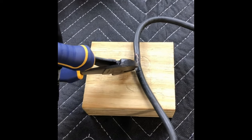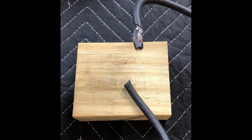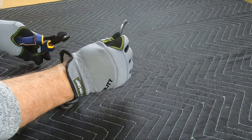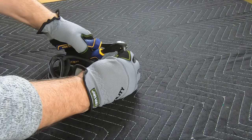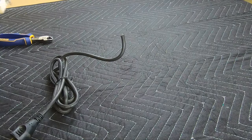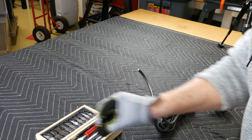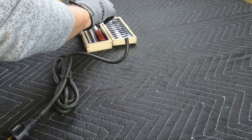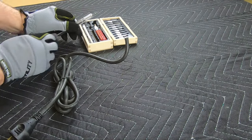I cut the cord into two halves and remove the damaged portion. This particular cord has a flexible but hard rubber shell with a cotton layer underneath, then the wiring under that, each wire having its own rubber layer. I feel confident that I can use my exacto knife and be careful enough to only cut through the top layer.